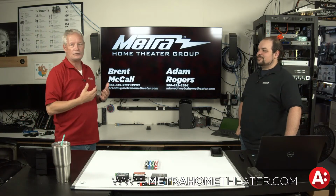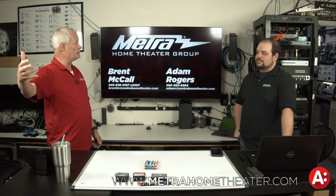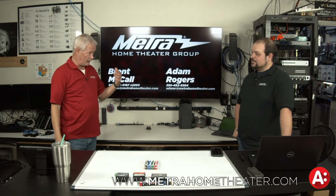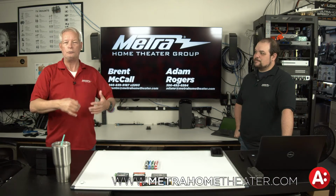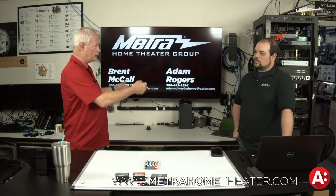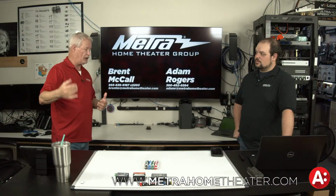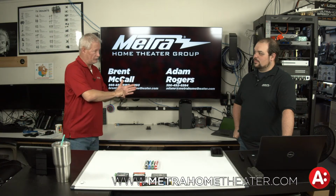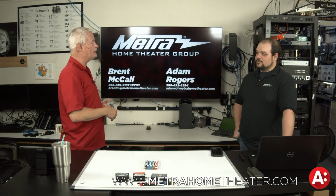So the very first thing we have to determine is whether the display input is working. Because if it's not, everything else you do is a waste of time and doesn't take you anywhere. Right. So typically how you do this is you take the cable going from whatever you've got to the display and you disconnect it from whatever's there, the splitter, the matrix, the switch, AVR, whatever, and plug it directly into a source. That's the most obvious place to start and probably the easiest.